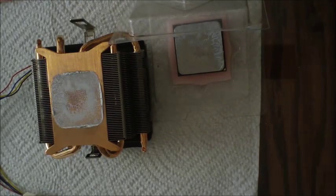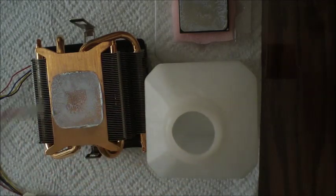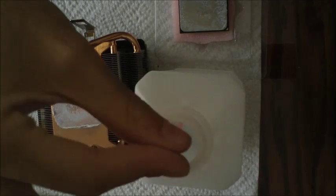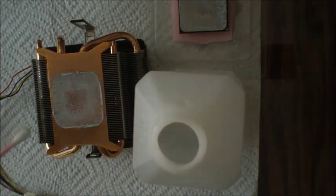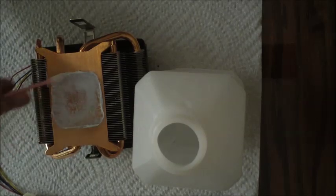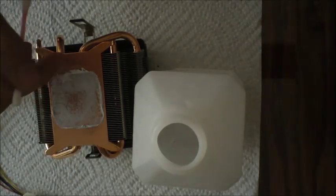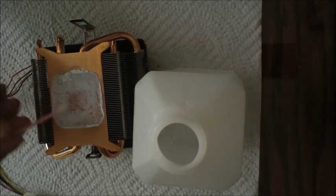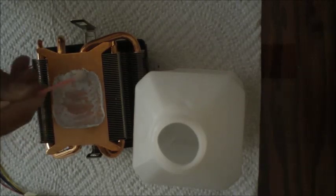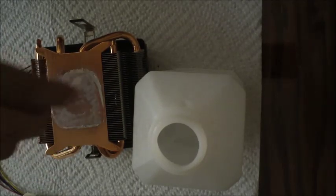What you're going to want to do is open up the rubbing alcohol and slide the CPU out of the way. Dip the Q-tip in — clean tip in — and don't re-dip after. Don't touch the thermal paste and then dip it back in because you'll contaminate the whole bottle. Make sure it's not dripping, especially when you go to the CPU. Then you're going to want to basically coat as much of the surface as you can and just let that thermal compound work its way off. It's sort of ridged up along the edges here because I put too much thermal compound on before — it wasn't hurting the system, just a little too much. So you don't need a whole lot of thermal compound when you reapply it. Just swirl this around and you'll start seeing a lot of that thermal compound come off.